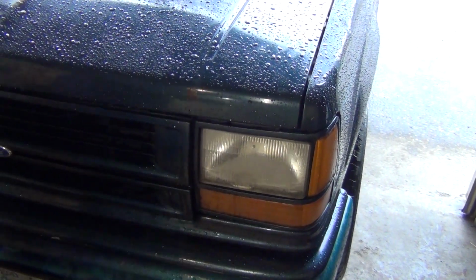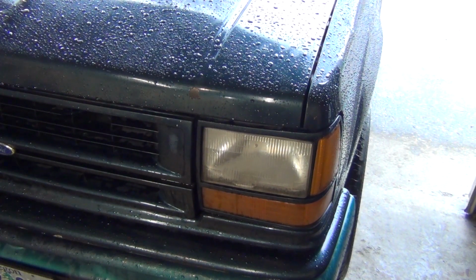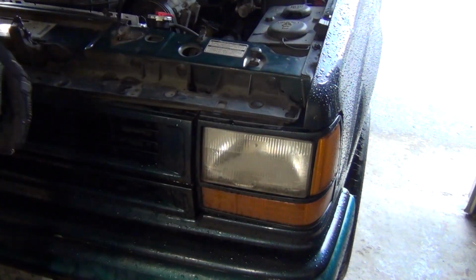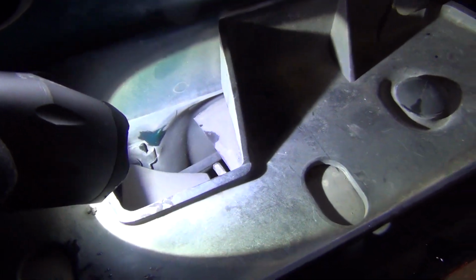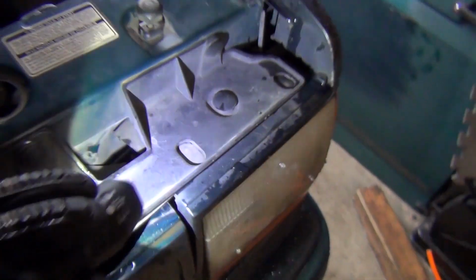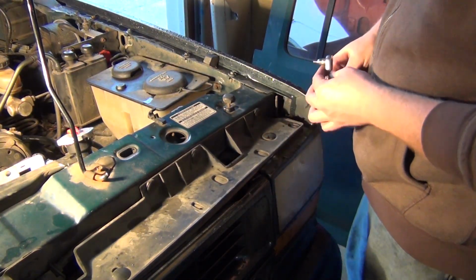But before we get too far ahead, this headlight here is bugging me because it's pointed off into the passenger side. The passenger light is about where it needs to be. Okay, I'll show you where we can adjust. So for up and down, you have that adjustment there. But then you have that one right there. So I'm going to see if I can find a socket and put a baby ratchet down in there and move it out. For whatever reason, it's tilted in. I don't like it. So what I found out, the size for this little guy is a 5/32, a little baby.